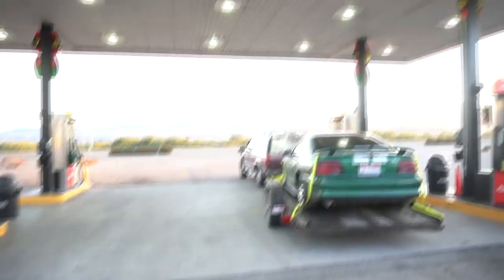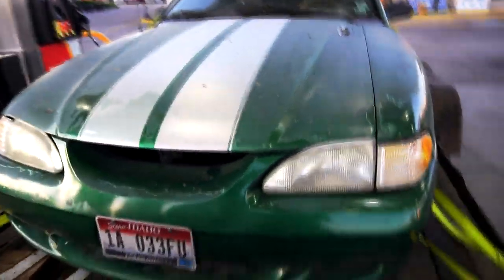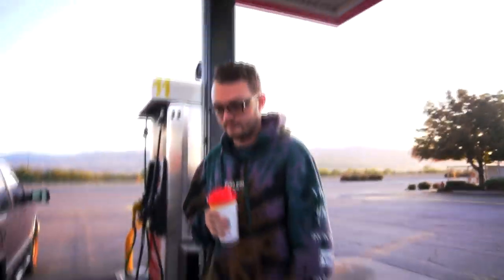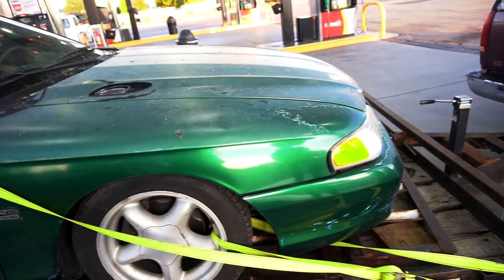Out here in Idaho we got views on views. Let me give you guys the rundown real quick if you're unfamiliar. This is a 1995 Mustang GT, 5-liter, 5-speed manual. QA1 full coilover conversion at all four corners, camber plates up top, camber maxed out, caster all the way forward. We've got a hydro, a bucket seat, stock 8.8 LSD. Gears are a little long but it works. Magnaflow or Flowmaster — something exhaust that's a little louder than stock. American Muscle 17s with some tires we can burn off. These tires are from the Engineering Explained S2000. We got her all the way lowered out and all the way stiff.